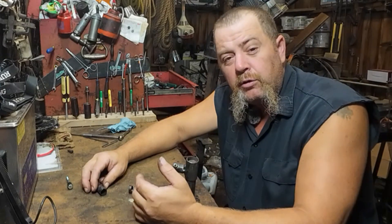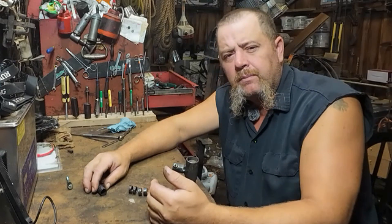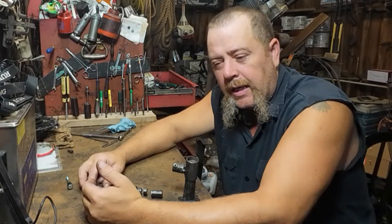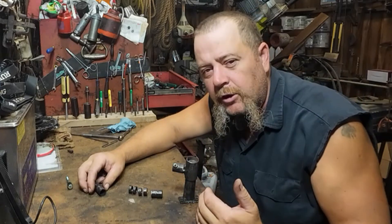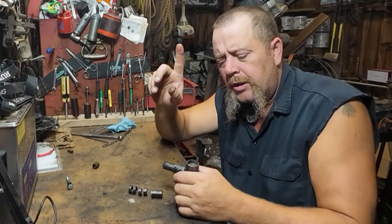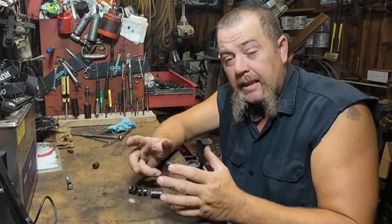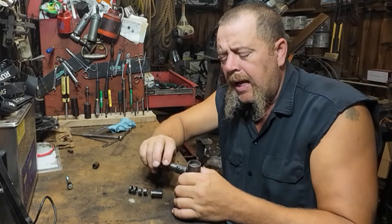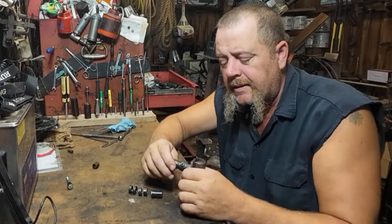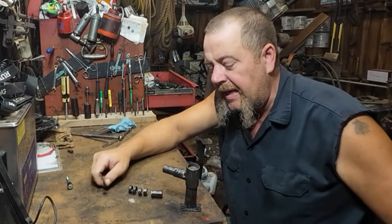It appears on this saw, at least, that you lose power faster as the pipe gets shorter beyond just your regular right length. If you get a little bit longer, you don't seem to lose power as fast. You can make it a half inch longer and not lose near as much power as if you made it a half inch shorter. There's another video where I was finding the right length of this tube with a heat gun — it turned out to be just right there again. Just cut it off just past the hot spot, about a quarter inch past the hot spot. Funny — I was talking to Iron Horse and he'd done the same thing but without a heat gun, and he found that length too.